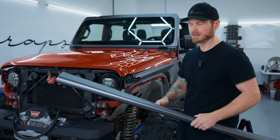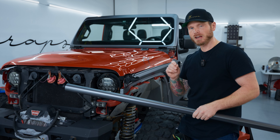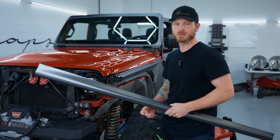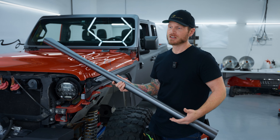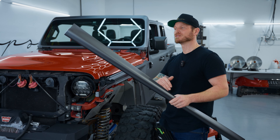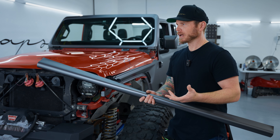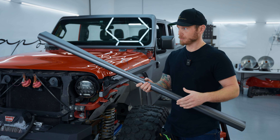The film is extremely pliable — it's incredible how pliable it is. It has air release. It is not pressure sensitive, but only really two brands in the market are pressure sensitive. This is TPU, this is paint protection film, so it's meant to protect your car. We now get colors in it, which is pretty cool. There are currently about 12 colors for Vivid, and Flexi Shield has a bunch. Vivid is planning to have about 50 or so.